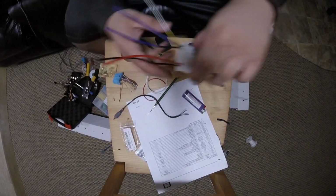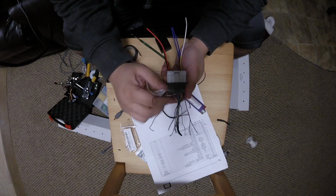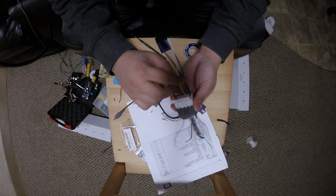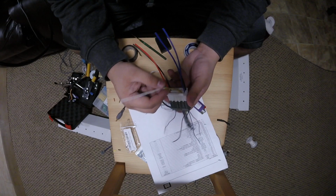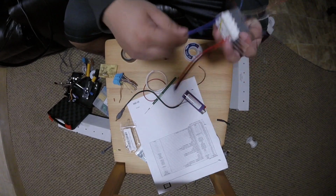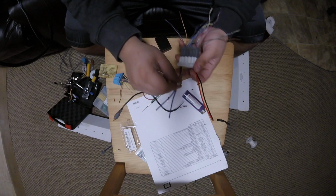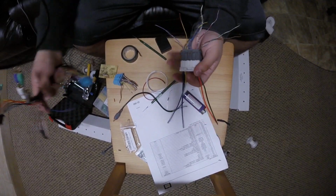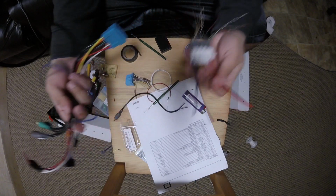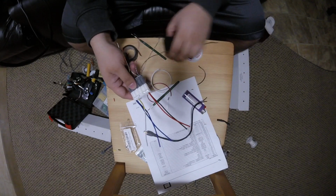Alright guys, so we lined up each of our wires with each of our pins, meaning your subwoofer positive, your subwoofer negative. For us, our positive is red, our negative is black. It makes sense. Then we have our amplifier turn on, which is the white wire we put yellow shrink tube on. Then we have our CAN bus, positive and negative. So here's where we're going to tie in our resistor. I'm just going to tie this off, cut it down. This is going to go to our other harness, which is why we put that blue wire apart like so. This is really the only wire that connects them. And then this wire is where we're going to hook up our subwoofer. And then we have this piece which ties it all together.